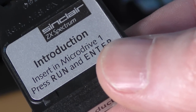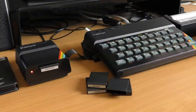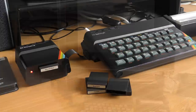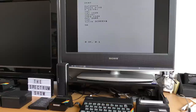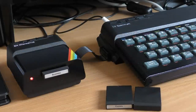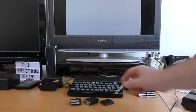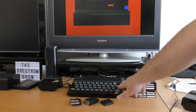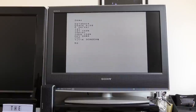The first one to try was the official introduction cartridge from Sinclair. This seemed to have great trouble reading the cartridge, showing file not found errors. I tried a few times. The cat command worked, showing the files, but they just wouldn't load. I moved on to the business cartridge next, and just the same thing — very annoying. To rule anything else out, I tested the same Spectrum, Interface 1, and cable with the V-Drive, and that loaded perfectly. So that really points to the cartridges themselves. I cleaned the heads on the mag drive, and still no joy.